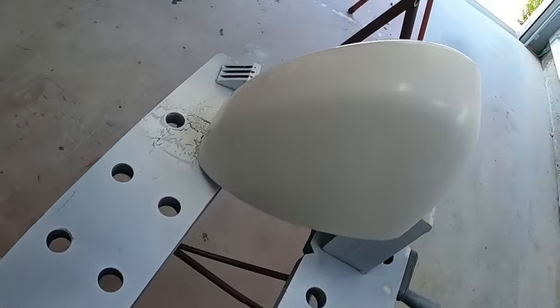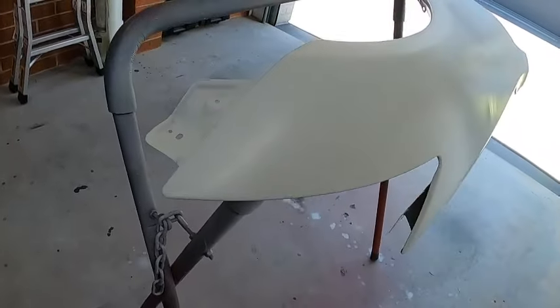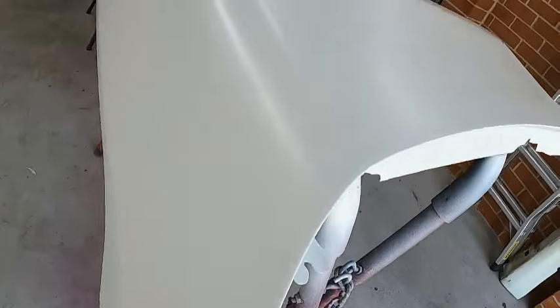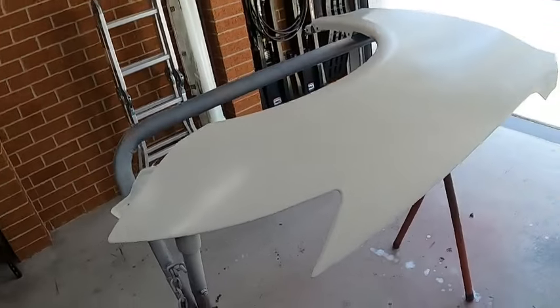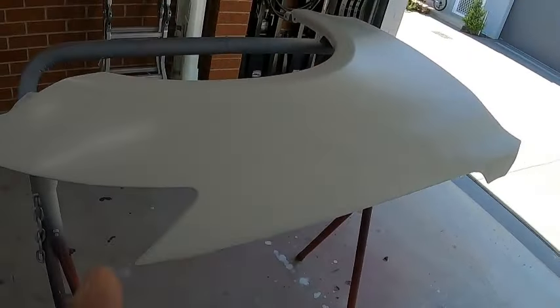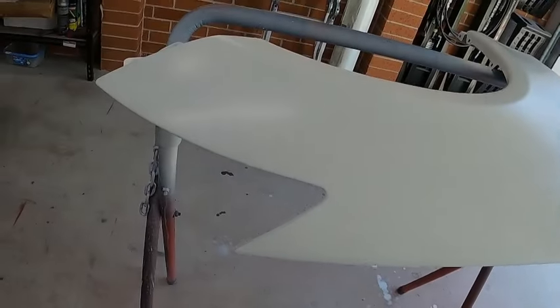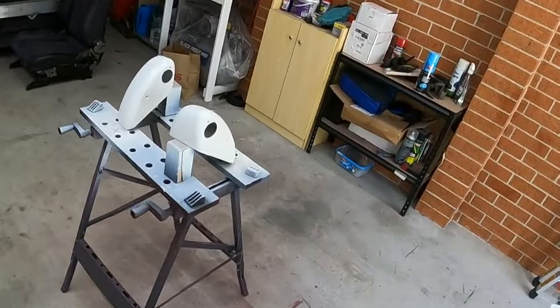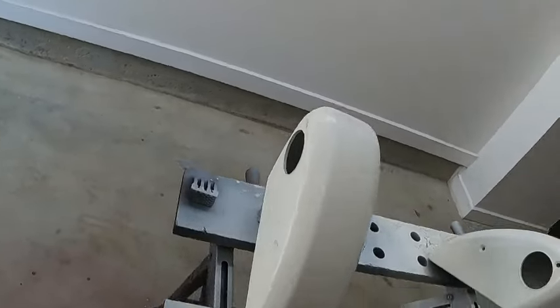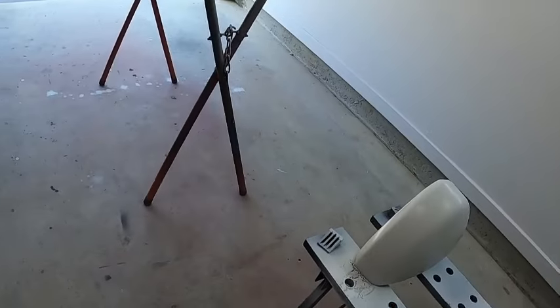Behold - new fresh paint. This is just base coat, I didn't apply the clear yet. I always use my trusty Chicago airless machine which means paint will have some imperfections - just like this spot over here, plus a couple of drops here and there. But overall white is forgiving, so in general I'd say this is a pretty good job. You just need a quick light sand then apply the clear. I'm going to focus on that one because I think I can spray it with clear coat - it looks almost perfect from all angles.